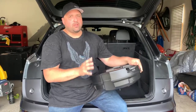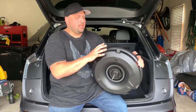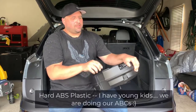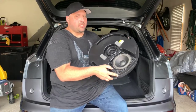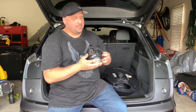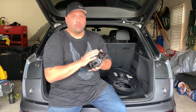First and foremost, I wanted to review the factory speaker setup. The factory speaker is located in the spare tire well in the trunk of the vehicle. You'll see that this is made out of like a hard ABS plastic and it has a speaker on the inside of it. I unscrewed the speaker just to show a little bit more information about it — this is a 40-watt, 2-ohm speaker, so not a lot of power is powering this particular subwoofer.